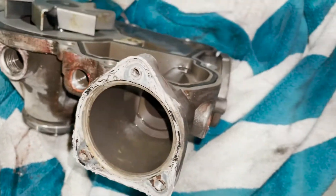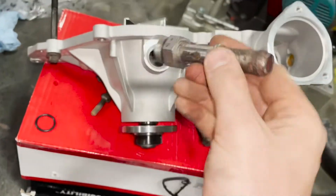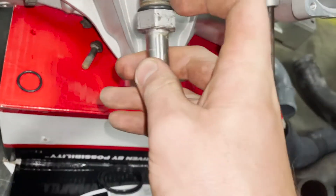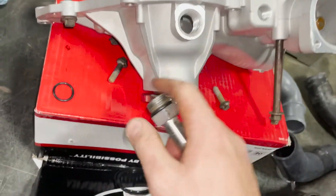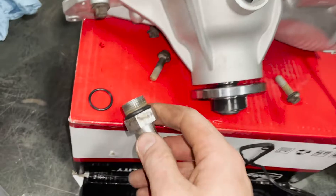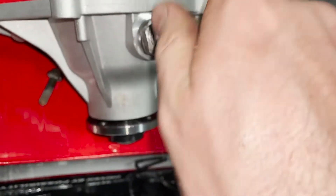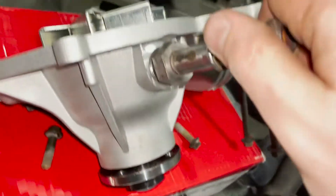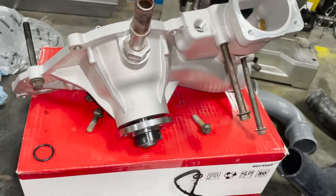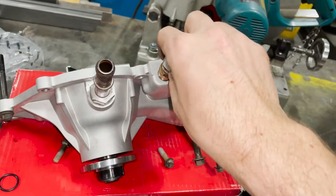The gasket all looked good, but it was intermittently leaking. It wasn't a bad pump — it just somehow developed a leak. I put that pump on about five years ago, and something I've been plagued with problems about is this nipple that goes right in here. The O-ring that goes on top of it — because they're not tapered threads, it just goes down and mushes down on the O-ring. It bottoms out on the threads before it really crushes the O-ring. Fortunately, I have a bunch of O-rings and I was able to choose a fatter one. Now when we thread this down in here, it should squish pretty nice and not have a leak there like I used to have — it would just be that little bubbly stuff coming out. I'm going to put some more sealant on that.